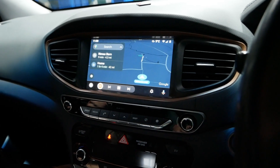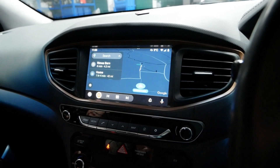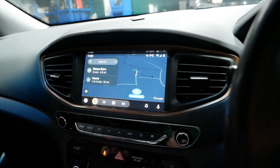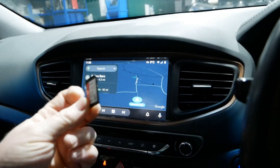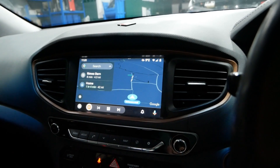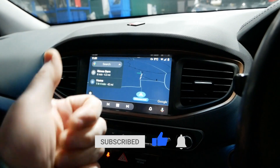Anyway, if you want to do the update it's all free on the Hyundai website and it's a relatively easy process. The files didn't get written to my SD card the first time — I'm not sure why — but when you take your SD card out of the computer, it's worth going into My Computer and making sure the card is populated with data before you go to the car. Apart from that, it's a plug-and-play and then a wait job. It's nice and easy to upgrade.